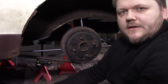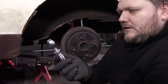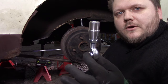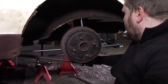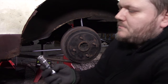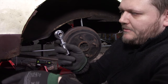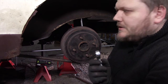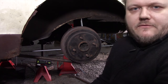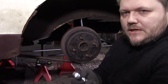So we're now 2 weeks later, and I've got those Heim joints or Rose joints or rod ends, however you want to call it. It's just called different in different parts of the world. But these things, including the welding bung that fits right into the tube, I can weld them, and we have an adjustable system. I don't know for sure if I'm going to use the Heim joints itself, or leave them off and weld a bushing onto it. I don't have to decide yet, because I can fit it into its place, and if I want to do it anyways, I can.